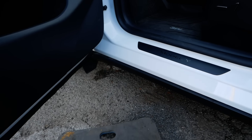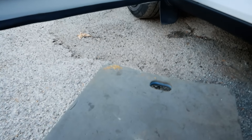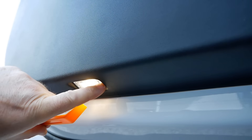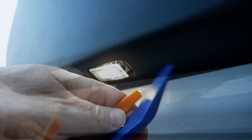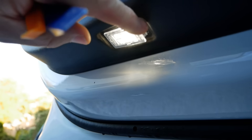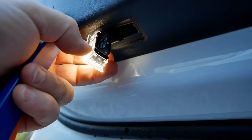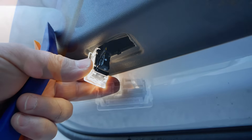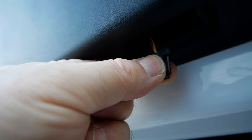Just do as they say and it will all work fine. There's the existing light under the door card — you just need to use a plastic trim tool to pry it out. The instructions show to pry it out from the front, pointing toward the door hinge end. It's quite stiff so I had to use the thicker tool and really put some force on. Once you snap it out you can get it out — don't pull it too far though as the wire is quite tight. Then just remove the electrical connection by pushing a screwdriver or plastic tool down and pressing the tag on top of the plug.